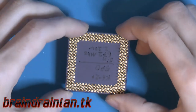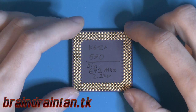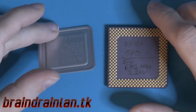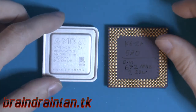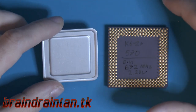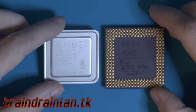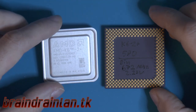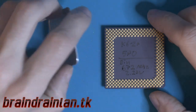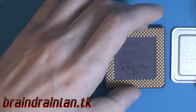There is a thread on Vogons for how to turn a K62 Plus into a K63 Plus, and that first of all involves the lid — you would have to remove the original IHS. This is a 570MHz K62 Plus, and apparently someone found a whole bunch of them and put them on eBay. You can buy a pack of three for $69, and last I checked they still had over 9000 of these kits — something like 27,000-28,000 CPUs still available.